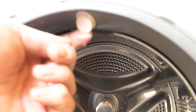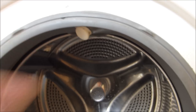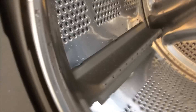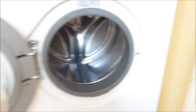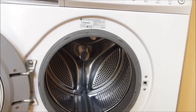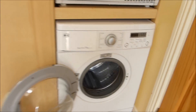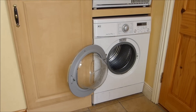This is a little jet and it squirts water onto the clothes being washed. The problem is if it gets blocked, or if the tube gets blocked — there's a hole in that thing and the water sprays out onto the clothes being cleaned. The problem is it gets blocked, and if you use washing powder, eventually it gets blocked up. You can call someone out — I'm sure they'll be happy for the call because it's an easy fix, but it's going to cost you money. So here's how you do it yourself.